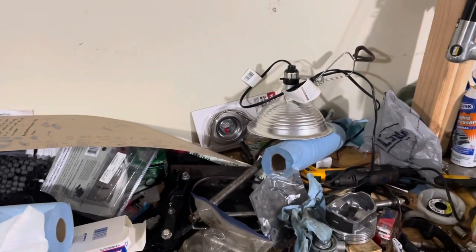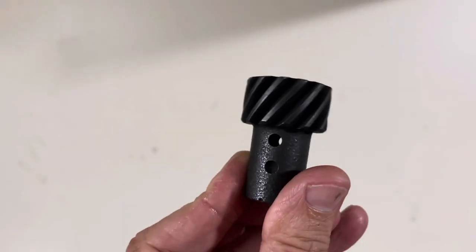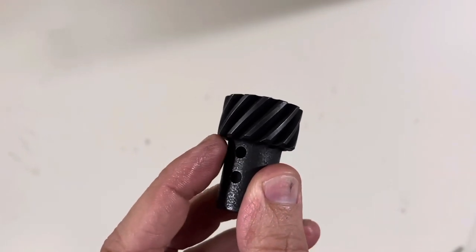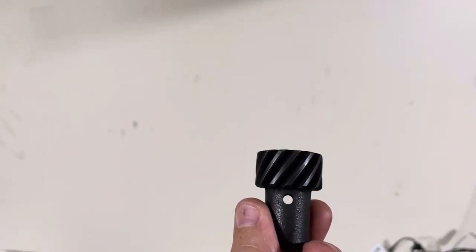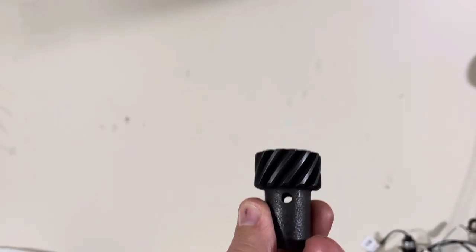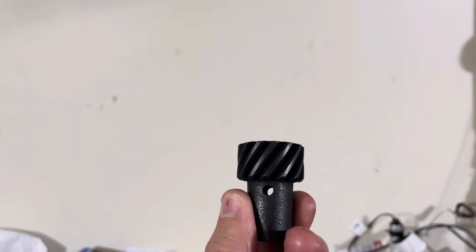What's peculiar about that dot — if you notice, the dot lines up, and if you follow it straight up, it comes in about halfway between two teeth. But if you spin this thing around, this hole right here is the roll pin hole that goes through the distributor — that's what holds the gear on the distributor. You can install this 180 degrees off. If you install it backwards, you'll see the hole on this side lines up directly under a tooth. So if you put it on this direction with this side rotated towards the rotor, on this particular distributor, it doesn't hurt you — and I'll explain that in a minute.